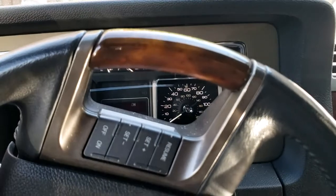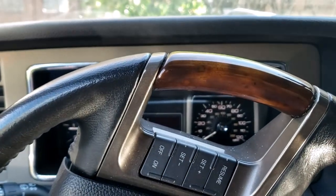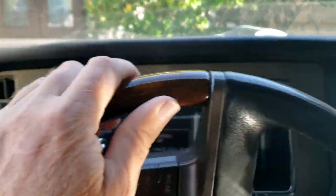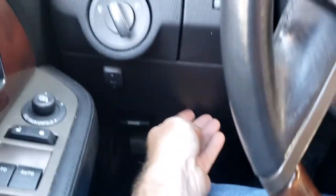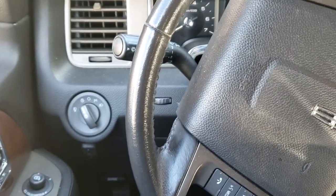The other thing I do is cut my wheel. If I'm going to be working on the passenger side I cut my wheel all the way to the left; if I'm working on the driver's side I cut my wheel all the way to the right. That makes it so I can reach the caliper a lot easier. Even though I am working on the brakes, I'm still going to pop the hood and take off the lid to the master cylinder.